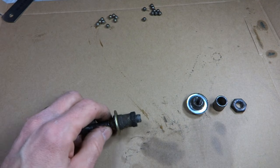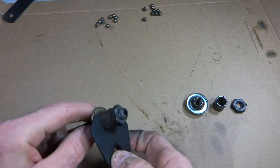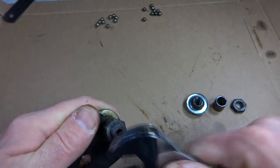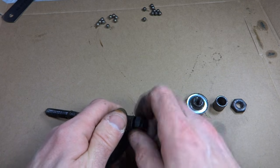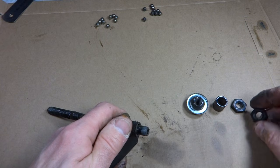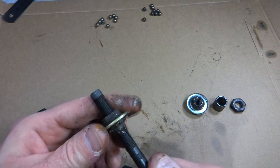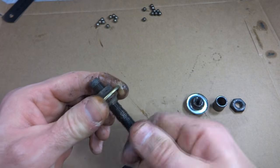And now I need to pull this side apart. So I can put a cone wrench on the cone there and loosen this lock nut here. And it looks like the 2 lock nuts are identical. There's the spacer. So the shorter spacer goes on the non-drive side, and I can pull the cone off here.